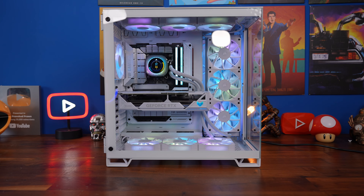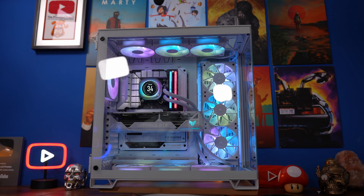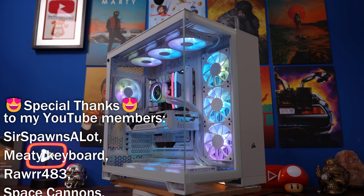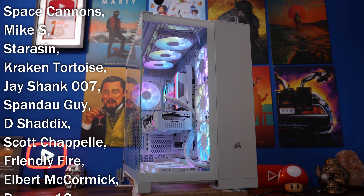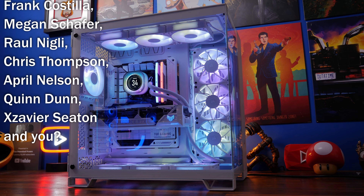There are some other things to bear in mind: you can't vertically mount your GPU with this style of GPU because the bracket wouldn't work and you haven't got any power connectors to connect up to it, so that's one downside. But if you want it in the standard format anyway — which is probably better for cooling — you can do it and you end up with a really nice system. Check out the links in the description to find out more.